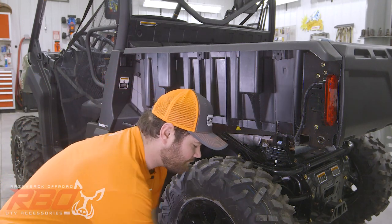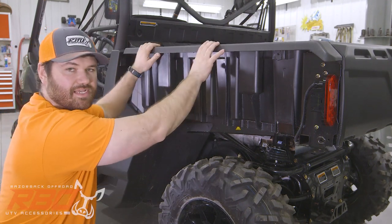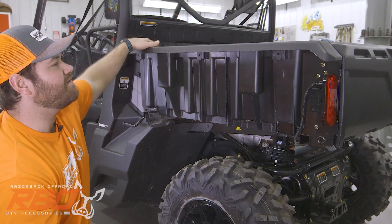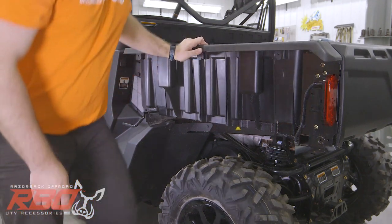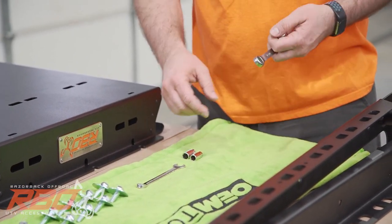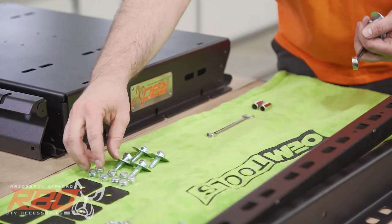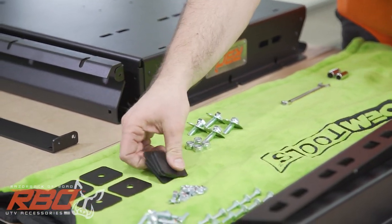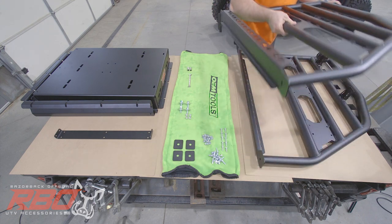Make sure you save your bolts. Now you have all the access you need to mount the sides onto the machine. You're going to be using four out of these five mounting holes up here on top. For that you'll need your 9/16 box wrench and 9/16 socket, and you're going to start with four of the 3/8 bolts, four nylock nuts, and four of these mounting plates. Then grab a side and go install it on your machine.